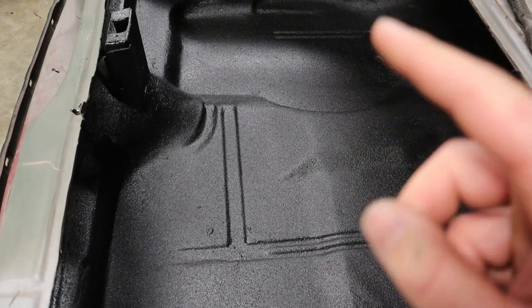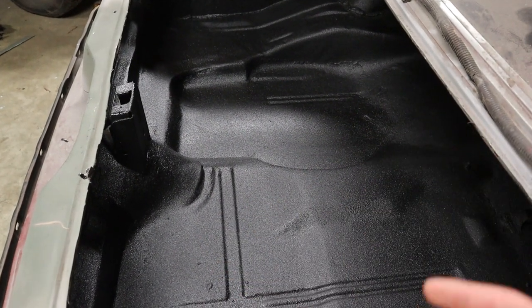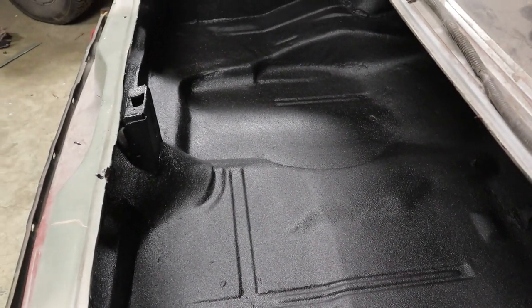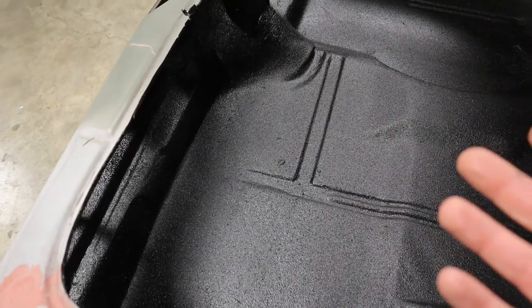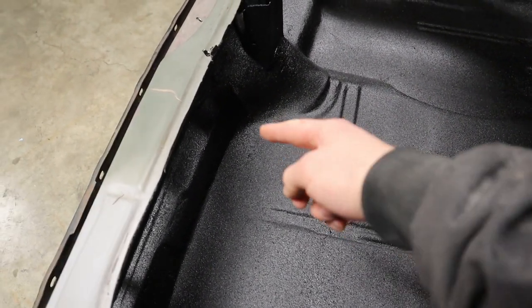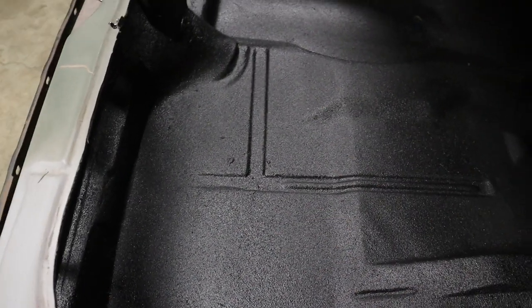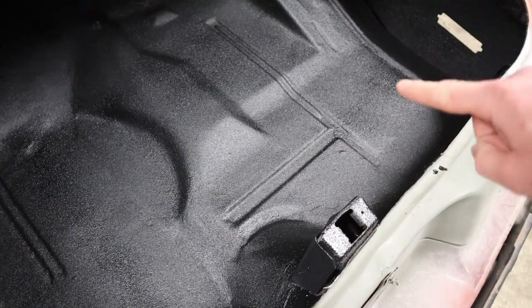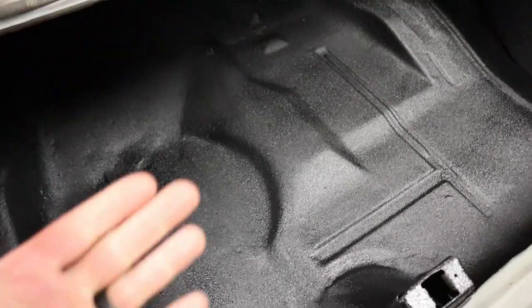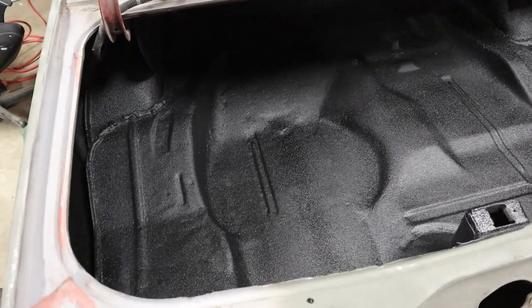All right guys, we're finished up here and everything is looking really, really good. This was months of work to get it to this point — not consistent work, but just doing things here and there as I could — and I'm so glad I did, because look at this, this is really good. One thing that may look a little different than your fourth gen Nova setup is right here, because I kind of notched it back a little bit so I could get a nice flat area to put a fuel cell. This is two coats of Raptor liner, which is exactly what the instructions say to do. As you can see, the texture is nice and consistent — very happy with the way this turned out.